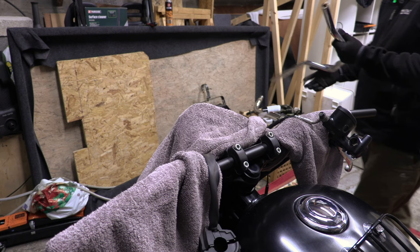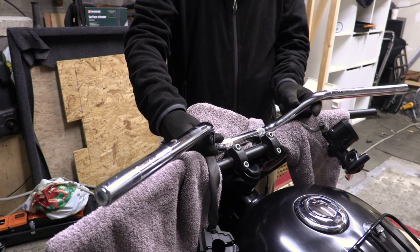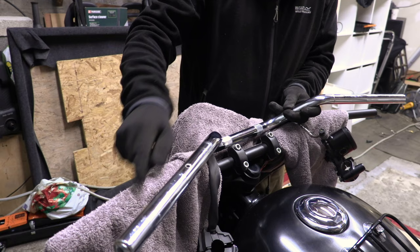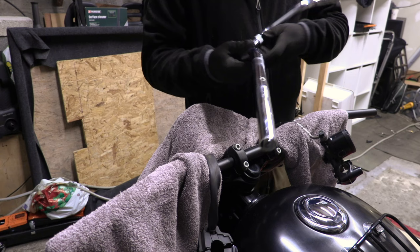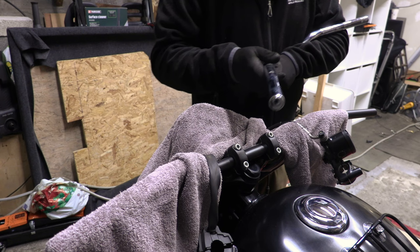Says a standard Meteor bars. Quite a difference, eh? So they were in there, and further forward. So we've come from here all the way down here. Now I was saying about locking marks, as you can see these two holes here. That's what the switch gear locks into. So the switch gear doesn't depend on the friction of those screws to stop them turning around. So a decision has to be made on where that is. It's not too critical because it's kind of obvious where they point, after all.